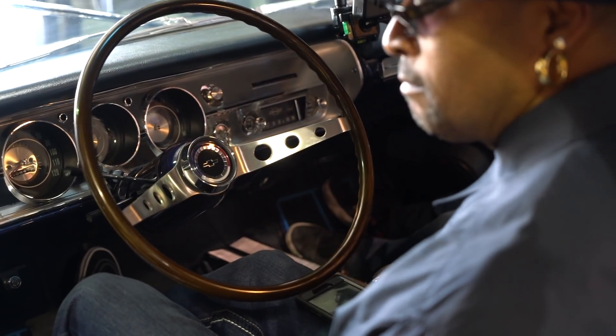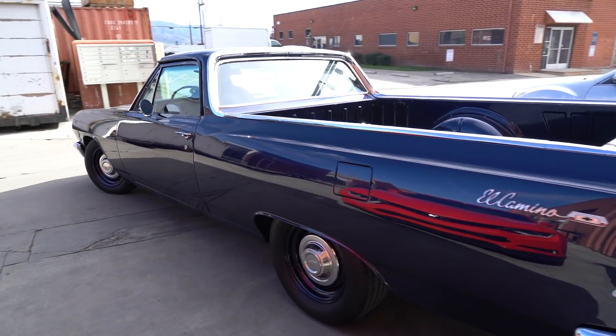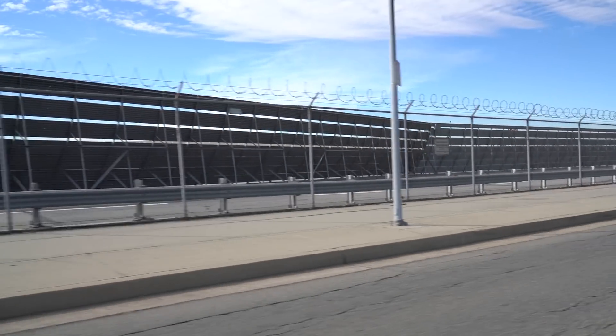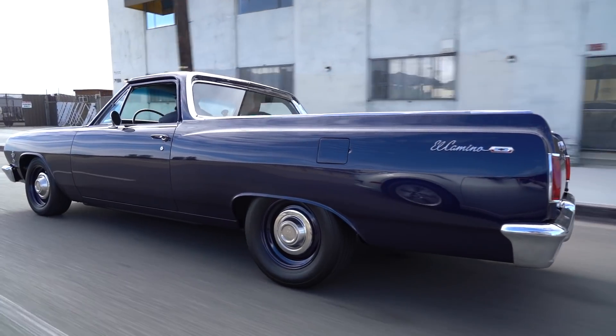Let's go for a drive! You can really feel that shift kit when it hits — it hits hard. His business partner Tony built the transmission, and Mimo built the motor. It's a three-speed — it started with a Power Glide and was moved up to a Turbo 350. He may change it to overdrive since he has a brand new transmission sitting at the shop floor, if he chooses.